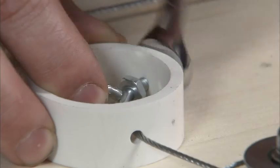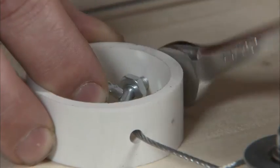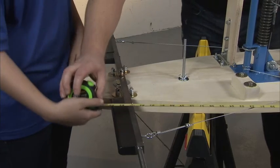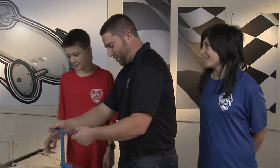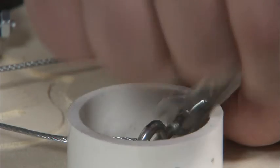Tighten or loosen the steering cables at the cable adjuster eye bolt until the length is exactly the same on both sides. Tighten the nuts on both sides of the cable adjuster. Check the measurement to ensure that it is equal. The steering cable should be tight, but not so tight that it bows the front axle. Make sure that the axle turns the same direction as the steering wheel. Tighten all parts of the steering assembly as shown in step five.